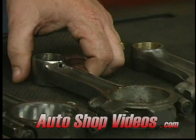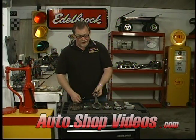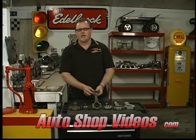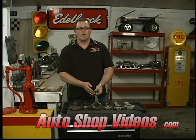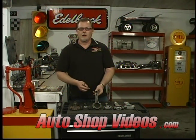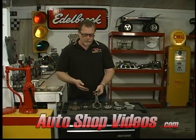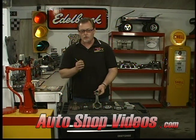This next one is a typical Chevrolet everyday forged rod. What people don't really realize is that almost all Chevy rods are forged — I can't think of a small block Chevy that had a cast iron rod. A lot of guys buy what they call Chevy 'pink rods,' but really all that was, was a stock rod that had been magna-fluxed to check for cracks. They came in Z28s and were available as performance rods from Chevrolet — just assured they weren't cracked.